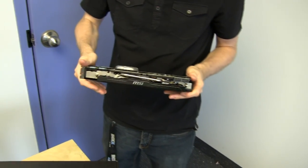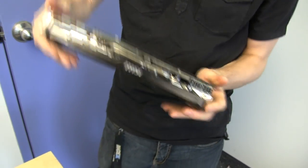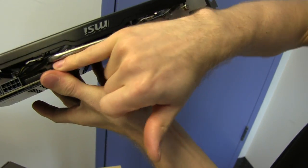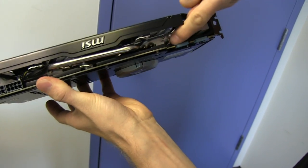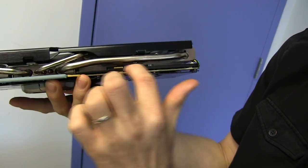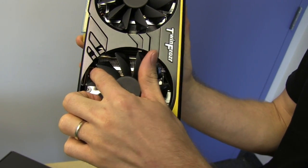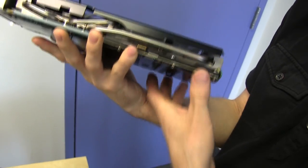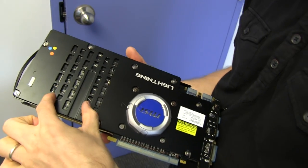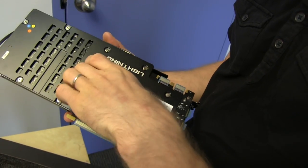This is one of the most rigid cards I've encountered. You can see it has almost no flex to it, no matter what I do, and that's for a couple of reasons. Number one, they've got a Unisync covering the VRM and the memory components — thick metal all the way here, all the way up here, giving it an amazing amount of structural rigidity. It also has a full backplate with a bit of ventilation around the PWM area.